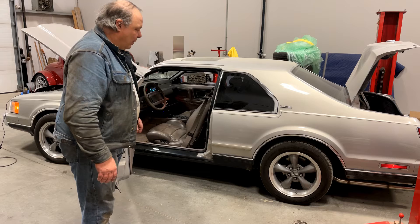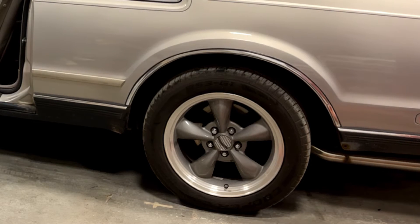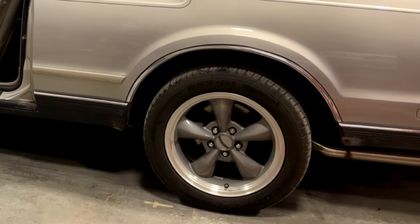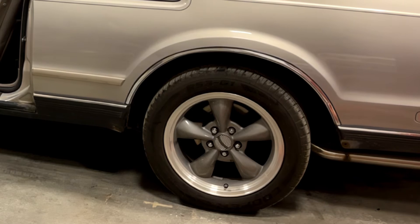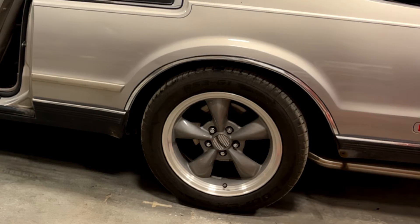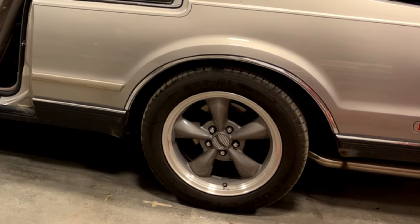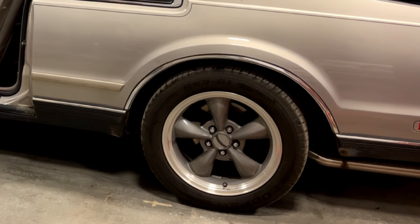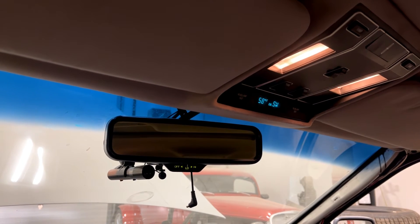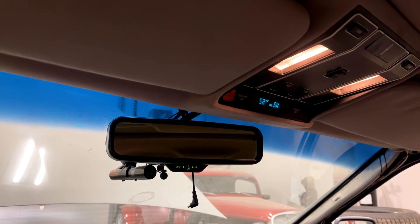The first test is the rear suspension test. If you look, it is raising the suspension up, then letting the air out, then raising it back up again until it gets an at-height value, and then it stops — completing the rear suspension test. The air suspension light is flashing a single flash, meaning test number one. If it passes, it flashes once for test one; test two would flash twice.